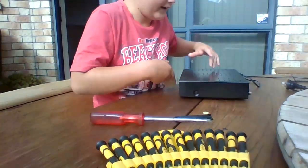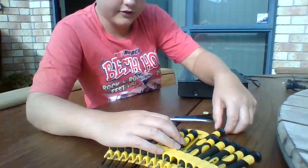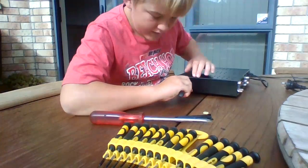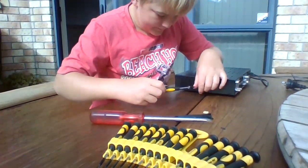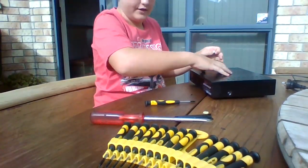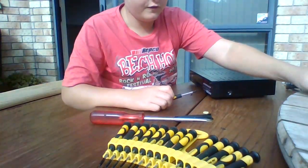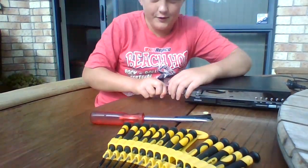Then what you want to do is head over to each side and get your screws — you'll need a pretty big screwdriver. Just unscrew the side screws and you should be left with three circuit boards: one on the front, one over here for the power, and one just around this area for all the controls. Make sure you don't lose any screws and sort them well — some screws may be a bit tighter than others.